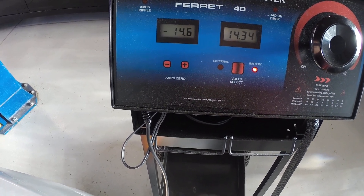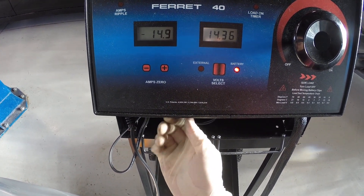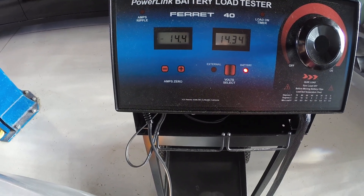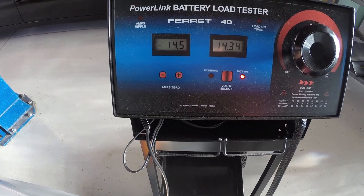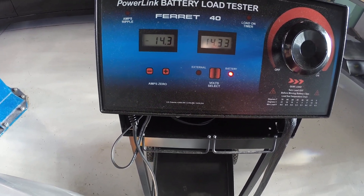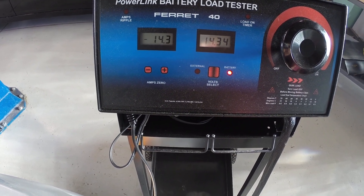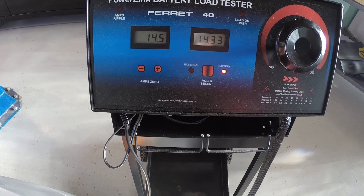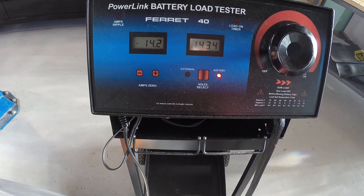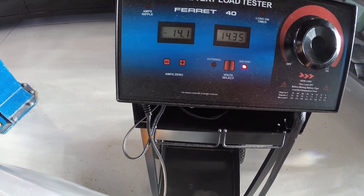Is that good? What's the normal specification for alternator output? Well, it depends on the alternator. I would imagine on a car like this, 95 amps is going to be pretty good. Most normal little cars like this are between 75 and 100 amps. Bigger vehicles might have an alternator rated for 120 amps. Some really special applications, like if this was an ambulance, we might see 250 amps. I think 95 is probably going to be sufficient.